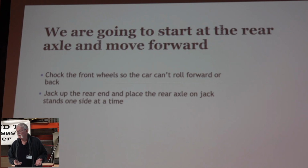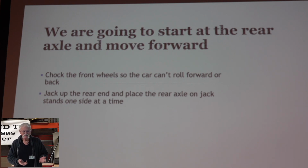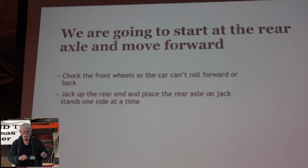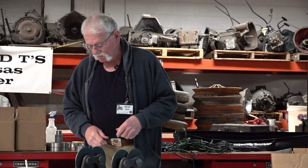There can also be other things wrong. You might have a loose axle gear. We've seen guys driving down the road and the axle and the wheel start coming out of the car. That's not a good thing. So there's one good place to look. You do that on the driver's side, because if the thrust washer disintegrates there, that's probably where there's the most stress; going the other way, you're going to hit the ring gear and pinion before something happens. But the thrust washer can be gone on the other side too. Still, that's a good place to start. You don't want that wheel moving in and out on you when you're going down the road.